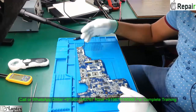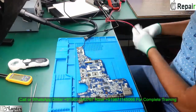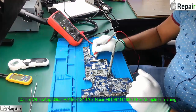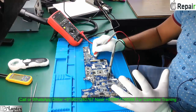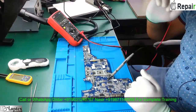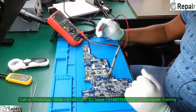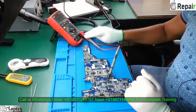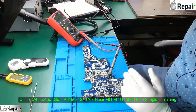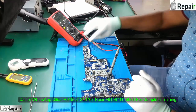As I told you, you have to check first the DC-in voltage. There is this stage, as I showed you in the diagram — how the adapter voltage is transferring into different stages, like the PLUS_VA voltage, PLUS_VAD voltage, and then it's going to the charging IC. The name is DC_IN on the first pin number of the charging IC.